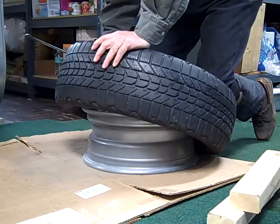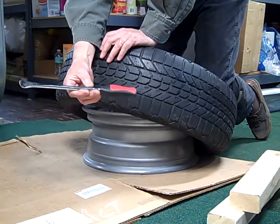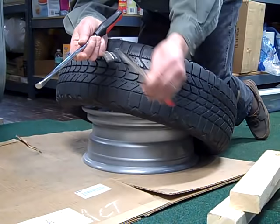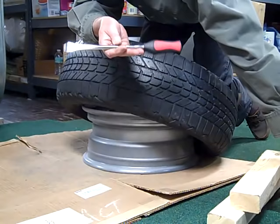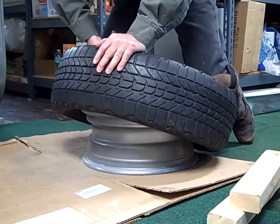I've got my knee pads on — you want to protect your knees. You're going to use your body weight to keep the tire down. I've got these cheap motorcycle tire tools which I really don't recommend; I got these on eBay for just a few bucks. When I was dismounting the tires, I had a fair amount of leverage on it and look how bad it bent. Even my cheap screwdrivers don't bend at all. I can use them for mounting because I'm not going to put that much leverage on them, and they've got a nice little spoon. Just keep your weight on there and work your way around.